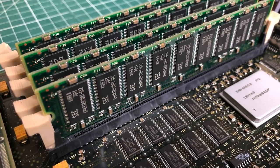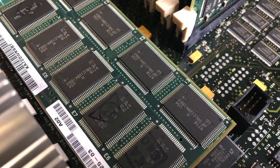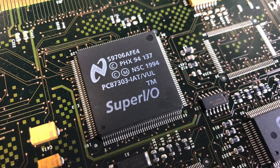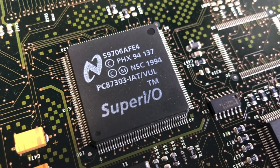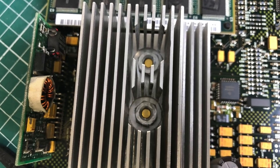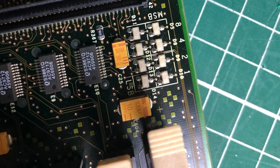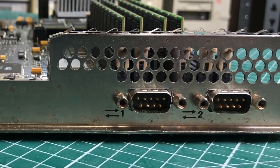The system is equipped with 128 megabytes of RAM and two megabytes of third-level cache. The capacitors on the board seem to be in excellent shape so I'm not expecting any issues there. There's a Super I/O chip which handles real-time clock, keyboard, mouse, and all kinds of stuff. There's a massive heatsink on the CPU with a fan mechanism attached in the case, DIP switches to configure CPU speed, diagnostic LEDs, and on the exterior side we have parallel ports, PS/2 ports for keyboard and mouse, and two serial ports.